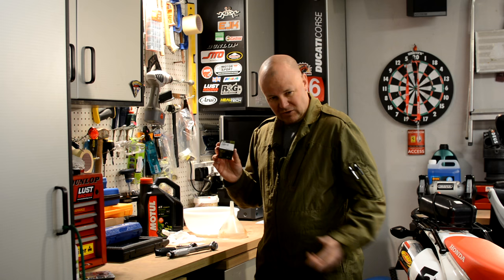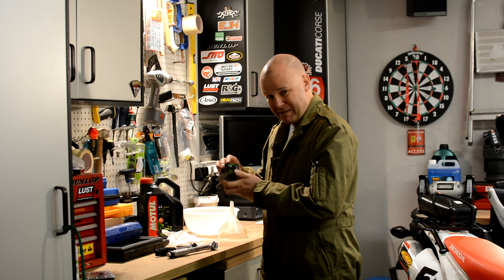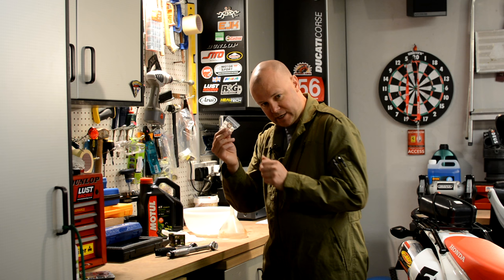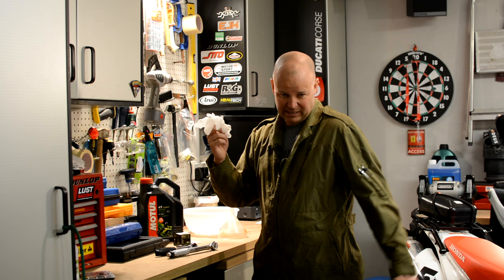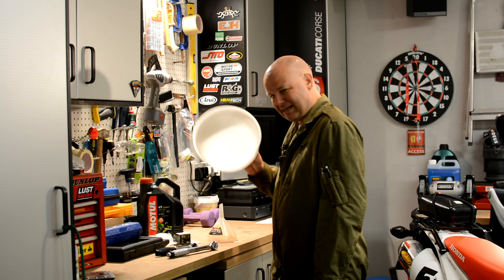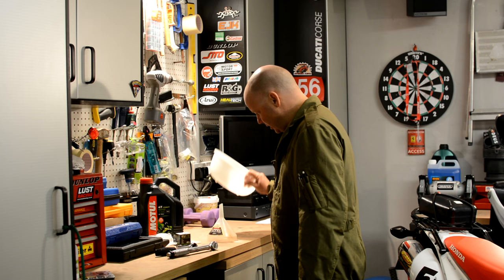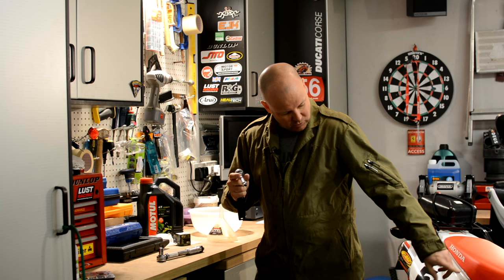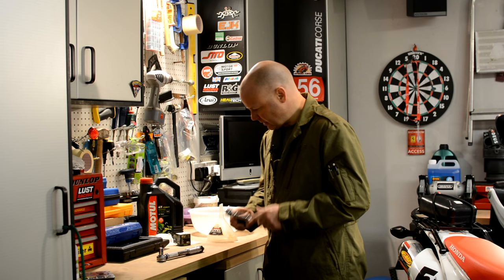Oil filter-wise, I've gone for a high-flow filter. On the CRF it's a little bit different to some other filters — instead of a metal canister you screw off, you get a paper filter that goes into a permanent receptacle. I've also got some spare washers for the little drain cap underneath — it's sometimes good to replace them and you have a habit of losing them if you're not careful. Other things you need: gloves, because this is a very messy job; overalls; a funnel to top the oil up; something to catch the old oil in — I've commandeered Mrs. Flyer's favourite mixing bowl from the kitchen. And last but not least, some wrenches — a torque wrench and a 12mm socket for the CRF drain bolt, plus another wrench with an extendable arm for the oil filter, because it's in the way of the brake lever.